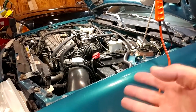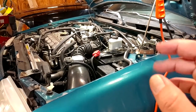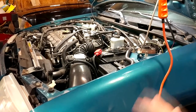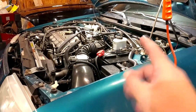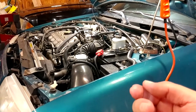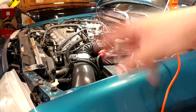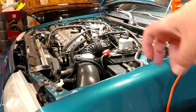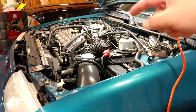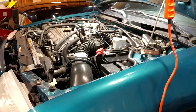So this sounds like a huge amount of work just to change the transmission oil, and it is. But if you have one of these cars, odds are good no one's ever done it before, and if you do it one time that's probably good for the rest of the life of the car. The only other easy way to get oil in the transmission is to jack the car up to one side and pour it in the axle hole.